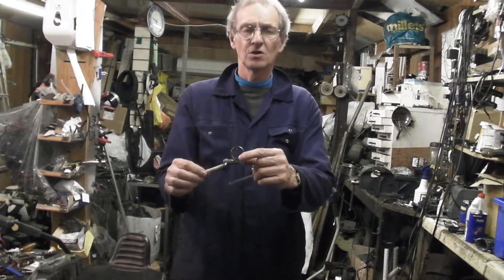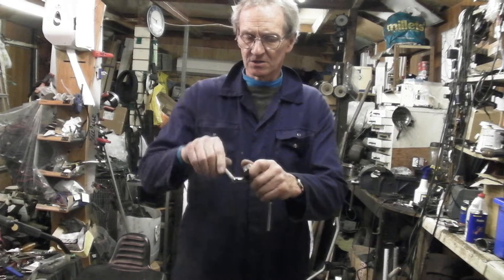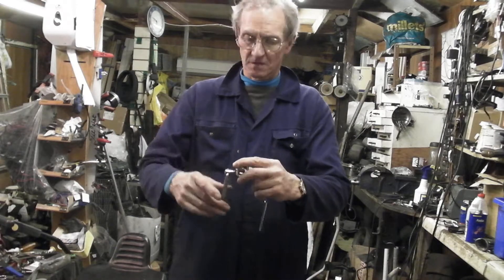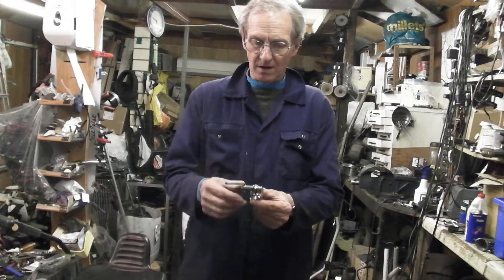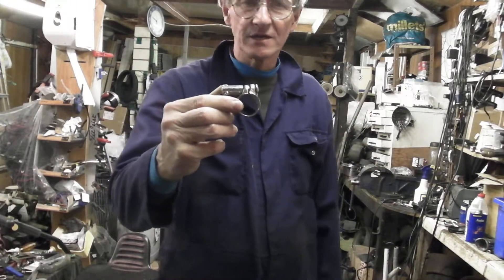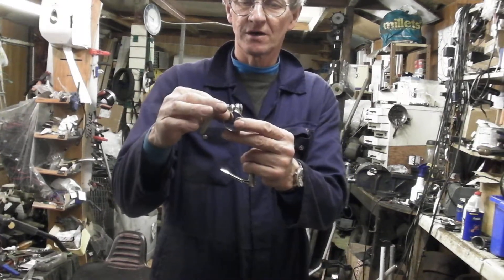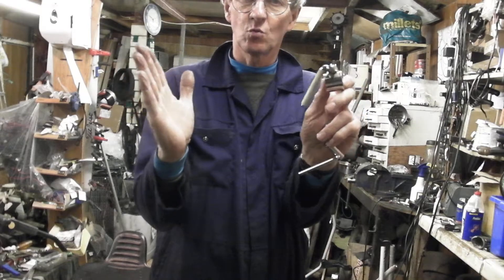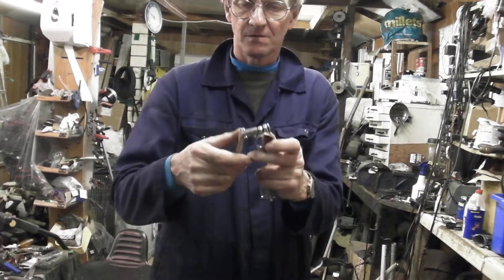This is the chrome clasp that holds the handle into the nylon tube of the chassis. This handle is unwound, the clasp spreads, the handle can be put in, and then this is tightened up and acts like a belt on one's waist. But we can see one problem with this one: the groove that is supposed to tighten up is already touching — it cannot be tightened up anymore. The only way we can make it tighten further is to grind back some of the metal so that the two wings can close up further than they did before, thus pressing the tube together.